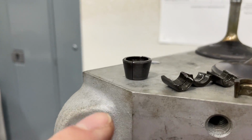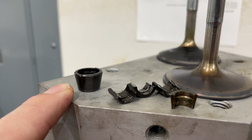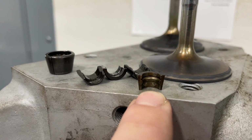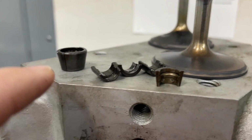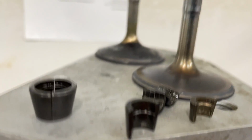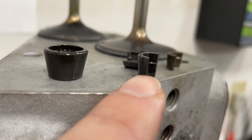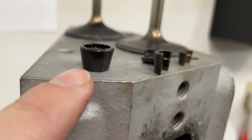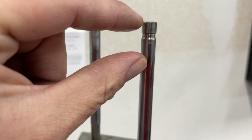10 degrees, this is a square one. We use it for a lot of stuff and really haven't had any issues, even though that's a square groove. Even though it's LS, they use them on hydraulic rollers. Solid roller, they'll use a different setup altogether. Now, 7 degrees aren't the end, doesn't mean it's all horrible stuff, because they have something called a Super 7 lock. It's a 7-degree like this, but it's much taller. It's even taller than the 10-degree. So it actually supports more of the valve area itself.